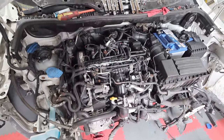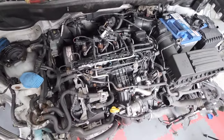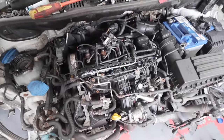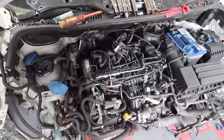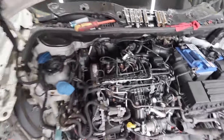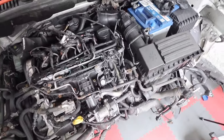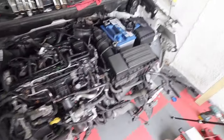If that is the case, simply changing the head gasket could save us a whole heap of work getting the whole engine out. I'm at least going to do that — take the head off today, look at the gasket, and see the state of play. If there's no sign of wear and tear, having the head off will also make the block and gearbox lighter to remove, because trust me, these things are heavy.